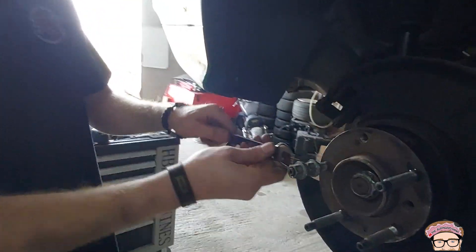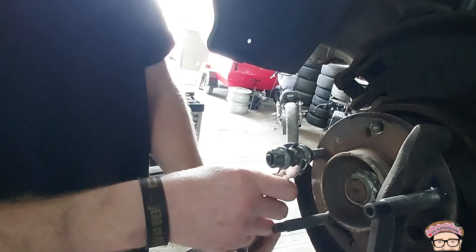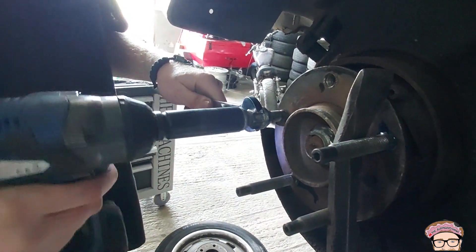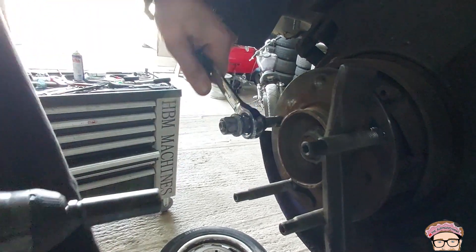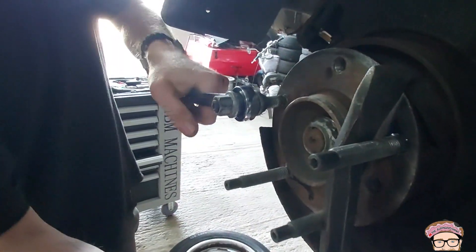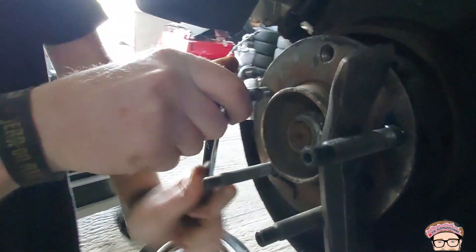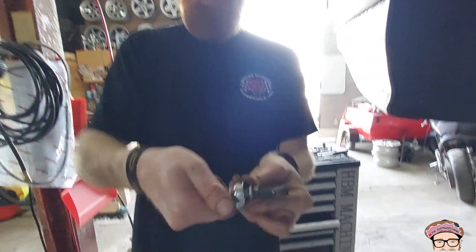You put a nut on, then take another one — that locks it. If you take the first one, with the body locking it for you, you can undo the whole thing. If you want to tighten it, same process but you tighten on the first nut. It should come off fairly easy. If you want to make your life easier, take that one off, put your ratchet spanner on — and there we go, it's out. Now just put this in the vice and undo the other one.